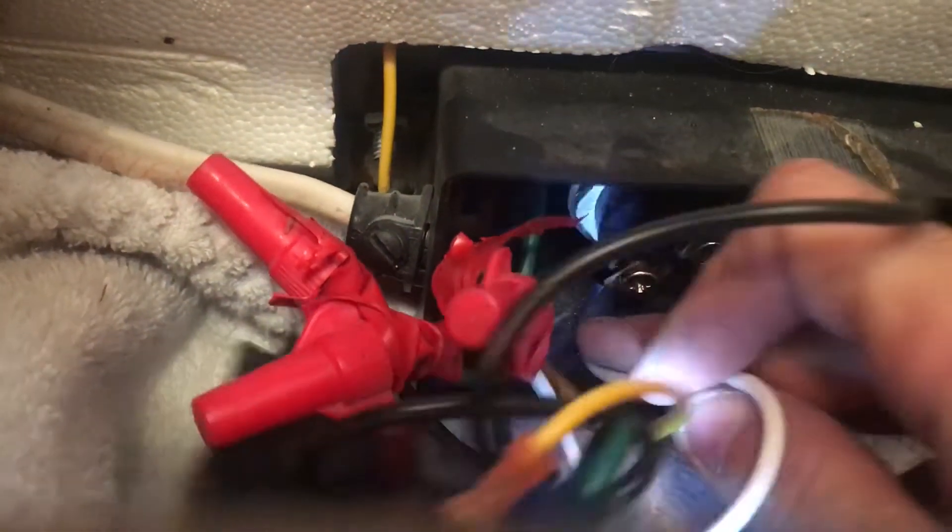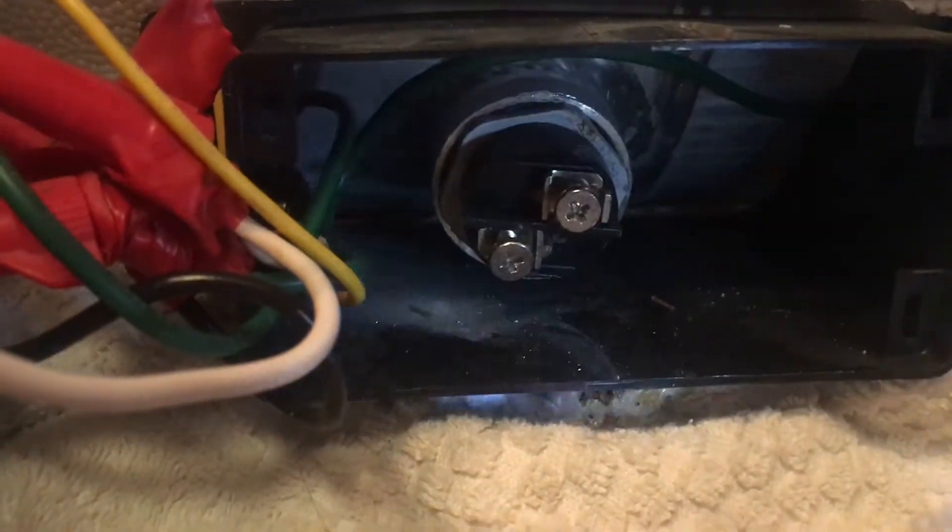Got that off. Now getting around the wrench and cranking this out. I got the flat head screwdriver in there just enough. On this particular model the element is facing towards me — I have seen other videos where it is on the side. Either way, you might need to take the unit out to do this job. Luckily the element was facing me and gave me direct access as long as I took out these little boards. I ordered the replacement element on Amazon — a link will be in the description for what heating element you need.